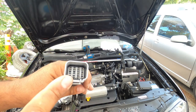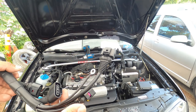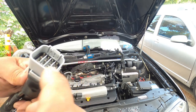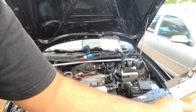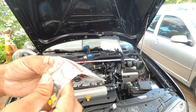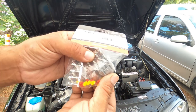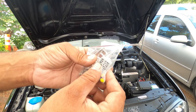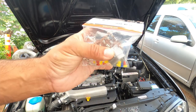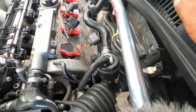We're going to have to wire it in with these new pins, so we're going to show you guys how to pin an entire harness. It only sets you back about 100 bucks for this kit. It gives you all the pins, little grommets, and everything to make the harness work correctly.